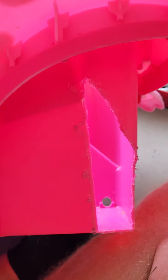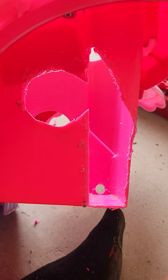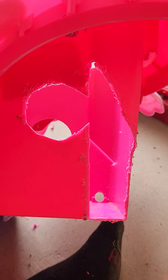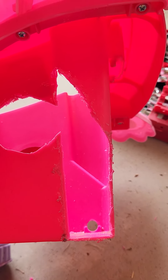I got the cut done. On the other side I've got a steeper angle, and there's a hole drilled for the motor to come through. I need to offset that hole a bit higher so the motors don't hit each other inside the toy. I'm going to have one hole here and one back here so the wires and motor don't interfere. The hole is a bit ugly — I didn't have the right size hole saw so I used a razor blade and Dremel — but they're offset enough that the motors should clear. Now I'll work on building up some plastic to hold the axle in place like the other side has.